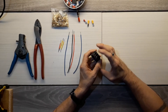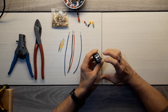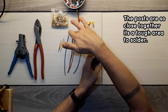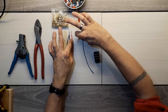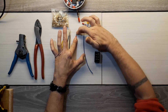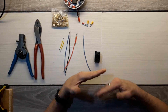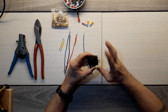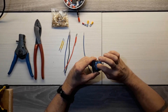For this application I will actually be using these clips. I don't like them normally, but for some applications they are good — particularly where we're doing jumpers from one post to the other. The wires are tinned together and we will solder the connections before they go into the clips. That will make sure they're not going to wiggle or create any gap. With electricity, any gap causes heat, and heat leads to fire. I've seen these melted in the dash where people did that, or tried to run too much power through them.